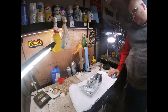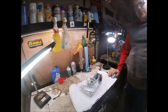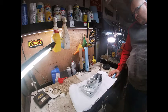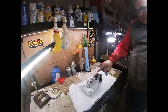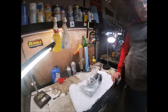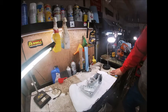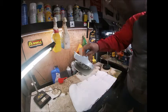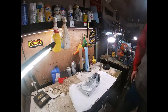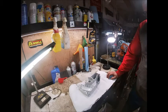Alright guys, we're here on the MS440 and we're about to do the crank cases. I have both case halves out here and I'm going to put them in the oven — it is okay to do that. These are nylon cage bearings but we're not getting them hot enough to hurt anything. I'm going to try 225 degrees. I've already got the crank in the freezer. This is the flywheel side — those pins you'd have to pull out with pliers, which is a good thing.